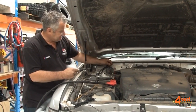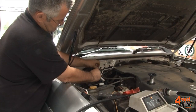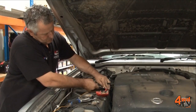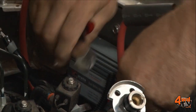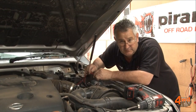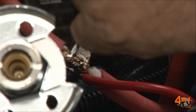We're connecting power to the ignition sense wire so we have to find a good ignition supply. Most of the time we run it to the wiper motor because it's a nice ignition power source. The next step is to connect up the main battery cable. We've mounted the fuse box up here and allowed enough clearance to get the wires around so it doesn't rub on the bonnet. We then run the cable around following the existing battery cable and connect it up to the isolator. Normally this would go to the battery positive, but because we're putting the battery in the back of the car it has to go to the isolator. We strip it and solder it into the isolator, which gives us power supply to the fuse box that then supplies fused power to all your accessories.